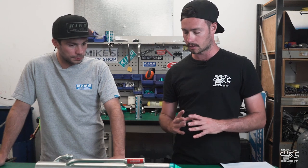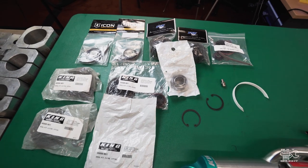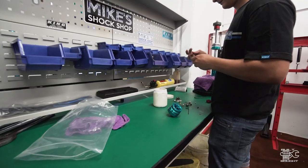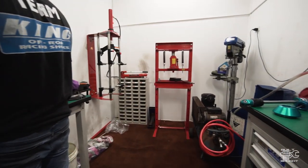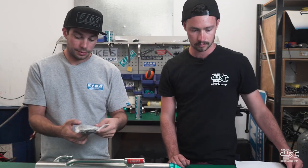You mentioned rebuildable - how can people know whether their shocks are rebuildable? About 90% of shocks on the market are not rebuildable. Most shocks that claim to be rebuildable are not fully rebuildable. In terms of fully rebuildable shocks, you're really limited to your high-end Bilsteins, your Kings, your Foxes, your Icons, your Radflows, your ADS - shock absorbers that have a racing heritage generally have a road variant that is still fully serviceable. A standard service is just oil, your hydraulic fluid, your seals, floating piston wear band, bearings, labour, and possibly a main piston wear band change.